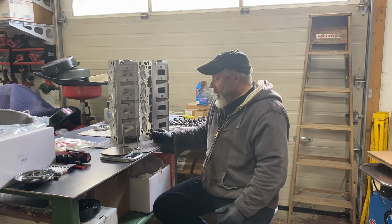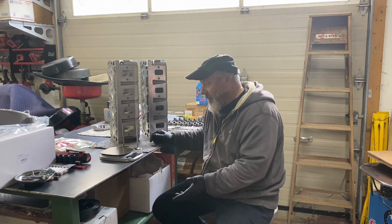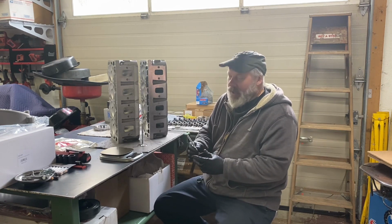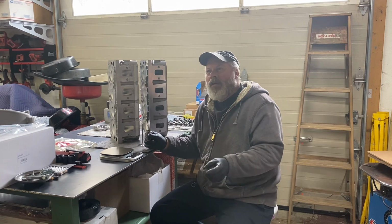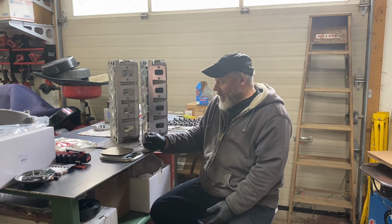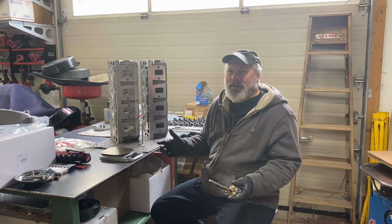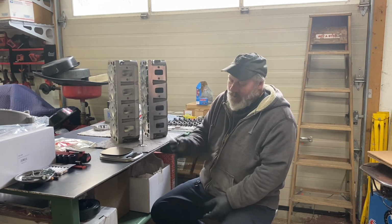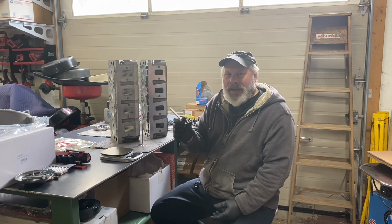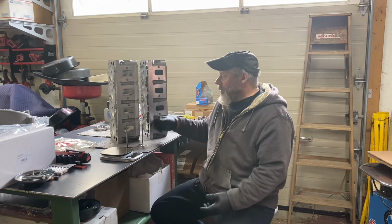This being my first dive into LS7 hardware, I didn't realize the valves I had were so unique. What makes them unique is the Dart head. A stock LS7 valve length, I believe, is 4.95, just under 5 inches, 4.950. That's way too short for these larger heads. I don't have any stock LS7 heads to compare to, but I'm going by specs I read online. So the valves out of the Ilmor engine that fit the Dart head are almost 5.5 inches. Titanium, this is the intake. I determined that these are way too long.